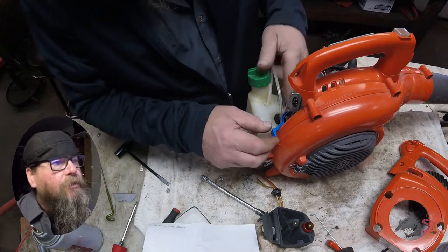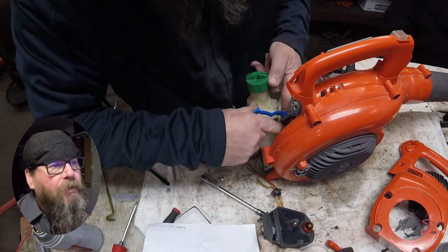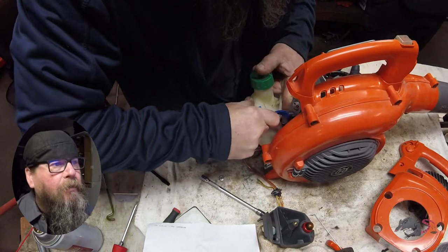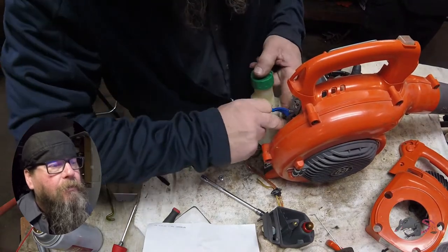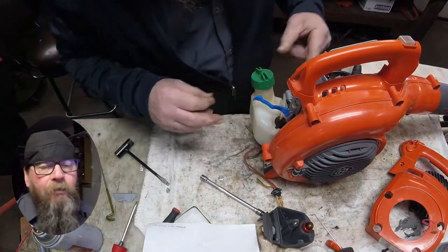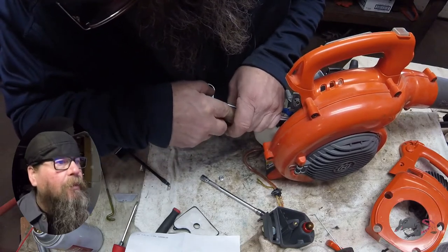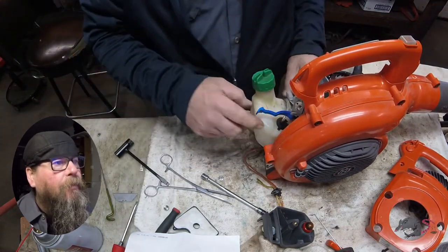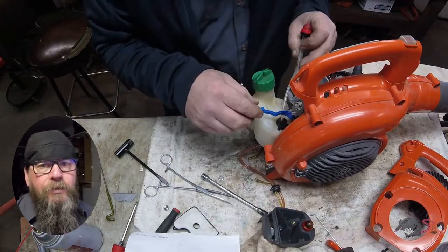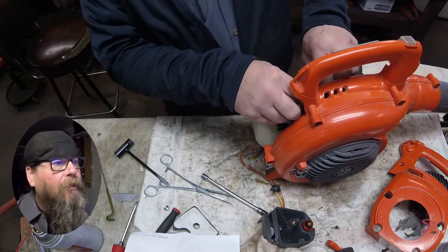Alright, you can see the short fuel line there — that one's got the filter on the end of it. I'm having to spin the grommet to get it close enough to hook it to the carburetor. Where the tab is right now is a more accurate location of where it should be oriented. We've got our line on the carburetor, and we're going to route the rest of our fuel lines on the same right-hand side of the carburetor, with lines pushed down first.